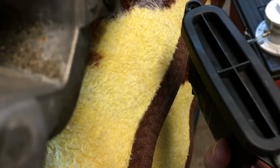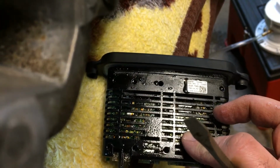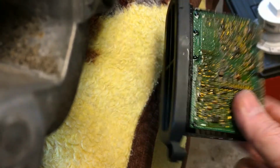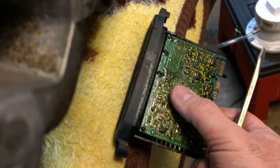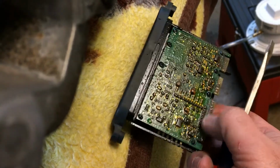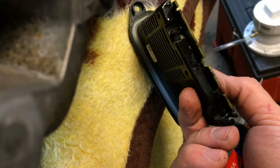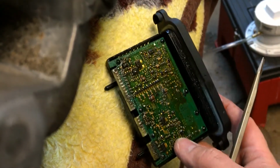All right, I'm going to have to replace this piece and hopefully restore the functionality. What we can do in the meantime is switch from the passenger side headlight just to see if that's going to make the halo and signal light come back to life, just temporarily. A quick test, but maybe drying this out, maybe wire brushing gently with a plastic wire brush, but I doubt it. There are too many components that probably got shorted. Who knows what happened.